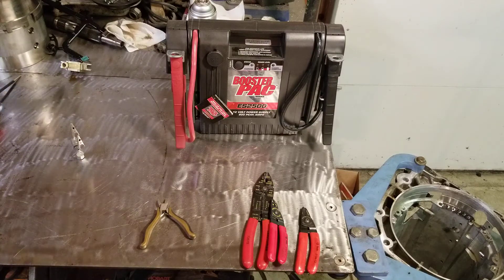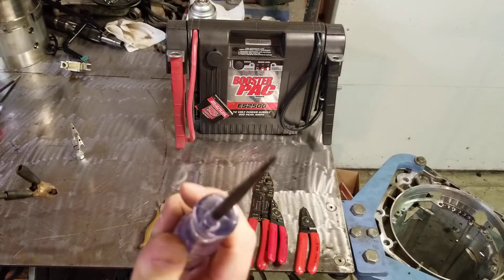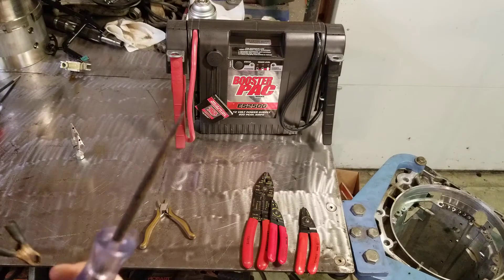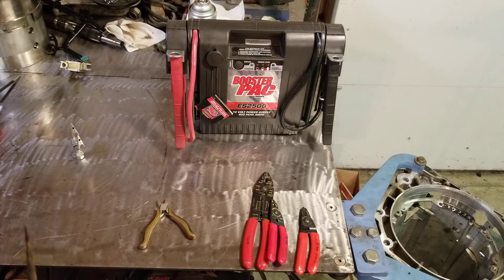Moving into some of our more diagnostic type electrical stuff — the test light. Now, they have a pointy end on this, and that pointy end is to get into small spots to check stuff, not to poke holes in insulation. Don't poke holes in insulation on wiring. What happens is moisture and salt get in there and corrode, and the wire rots off wherever somebody poked the wire. I've run into this where you work on a piece of equipment — a semi-trailer, a vehicle, a boat — and somebody's poked a hole halfway down a 50-foot trailer, and now you've got a light problem you've got to find somewhere in 50 feet of wiring.